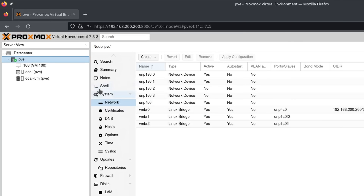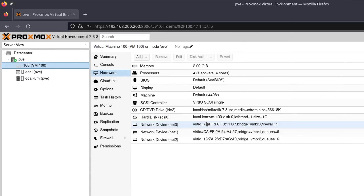Now in the Proxmox GUI we can see there are four new Ethernet interfaces added by this router board card. The first two are simply pass-through interfaces for the SFP28 cages and the other two you can use to your liking — they should be bridged to the management port. I've created some more VMBR bridges and simply bridged them to those two pass-through interfaces so I can assign them to virtual machine NICs. I've also installed RouterOS x86 here so we can test the throughput.